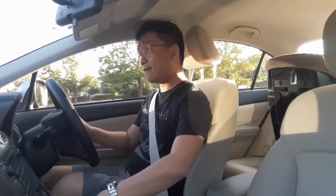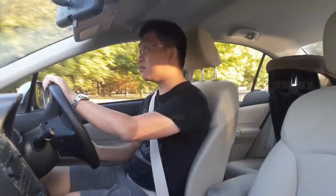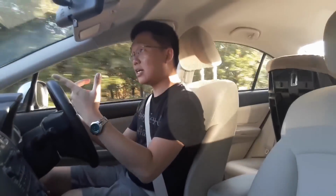Now the clutch is a little bit on the heavy side, but generally pretty okay to use on the move. It is only when taking off from standstill that the bite point can feel a little weak, but this could be a combination of the clutch aging and maybe being in need of replacement, plus the fact that compared to a front-wheel drive car, this is an all-wheel drive, and when you get going, the engine actually needs a bit more torque to pull the heavier drivetrain as well as to supply traction to all 4 wheels. So it requires a bit more torque than you would in a front-wheel drive car, and that is why when you take off from this car, you need to supply a bit more revs before you release the clutch.